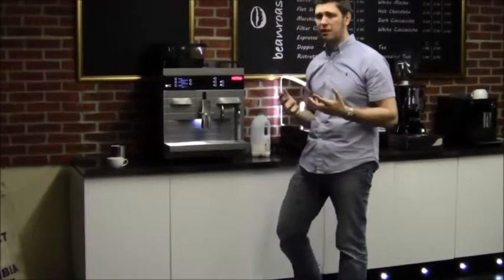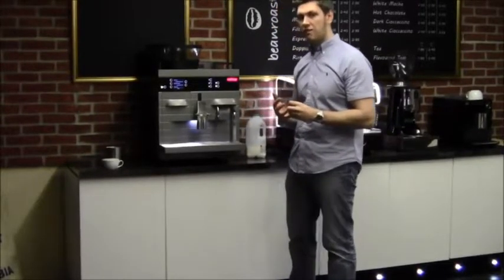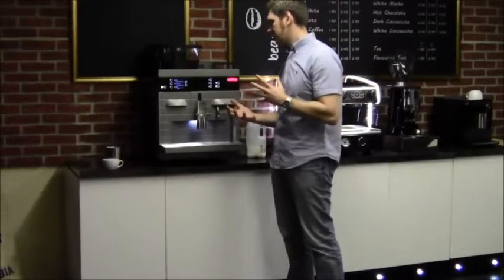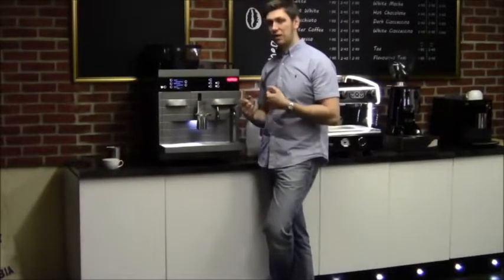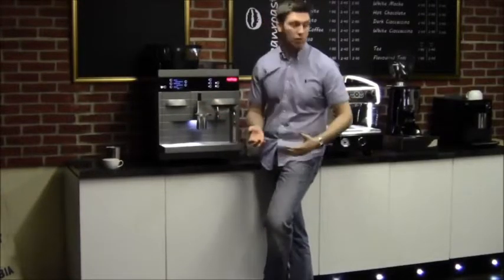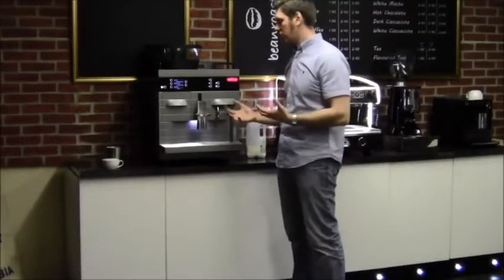The machine is very reliable with a lot of metal parts, so the benefit is that you're not paying for someone to come out and fix it all the time. It's got a huge boiler inside — in fact, it's got two boilers to be precise. The main thing with boilers is that if you've used bean-to-cup machines before, you've probably noticed the milk foam isn't very good. You need a real head of steam to create really good milk foam. Having these large, powerful boilers like you do on the Alfa really helps generate that and gets you the sort of foam quality you'd get out of a traditional machine.